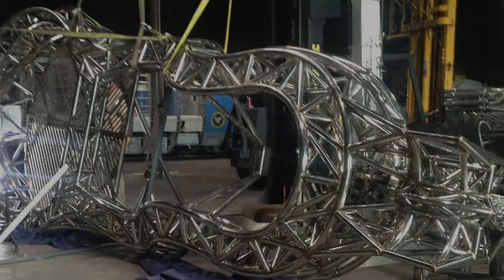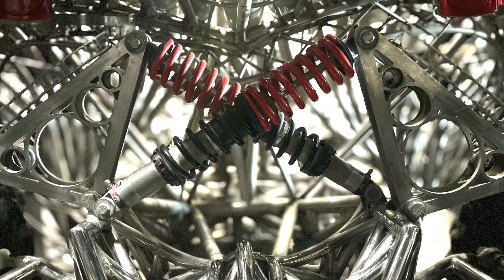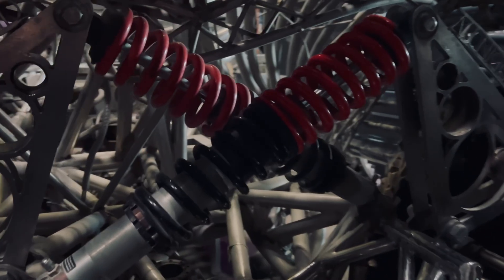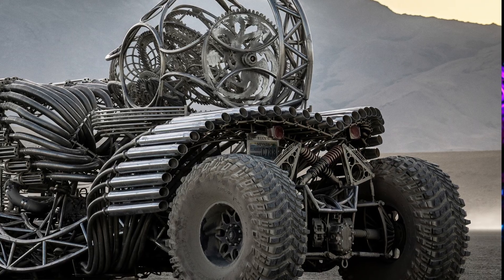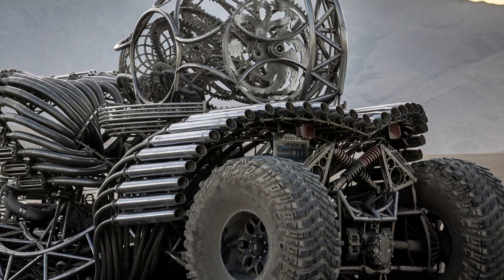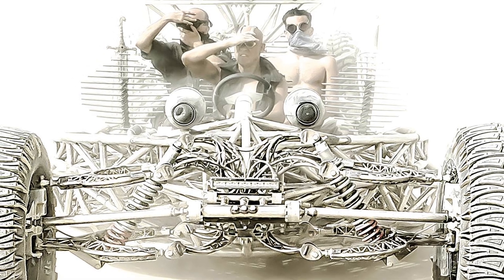The last bit, which is relatively simple compared to the rest, is this over-the-top shock arrangement. The shocks extend past the centerline of the vehicle, so they had to be offset from each other. Therefore the spindles are not mirror images of each other — one has the shock more to the front and the other has the shock more to the rear to avoid interference. It's a very volumetrically inefficient way of designing the rear suspension since it takes up more room than it needs to, but for this car we don't really care about that. I like to be able to see the suspension working and have it out there.